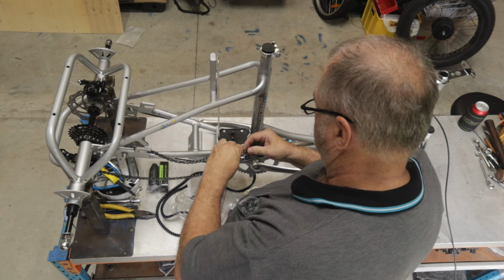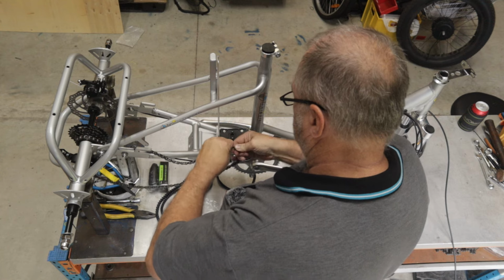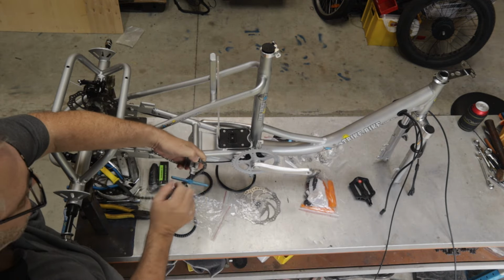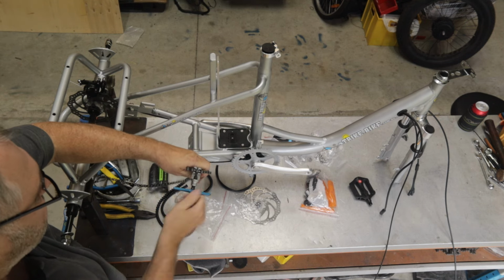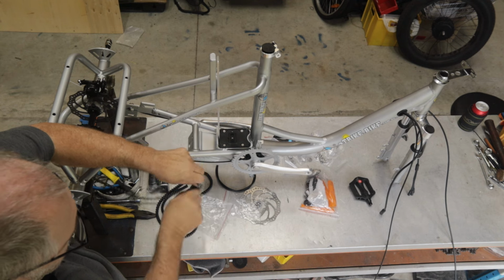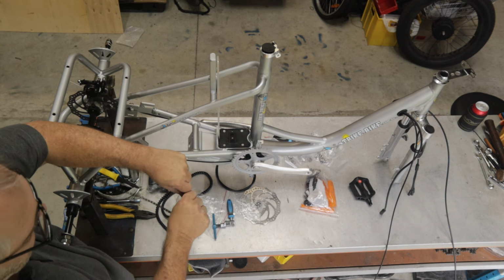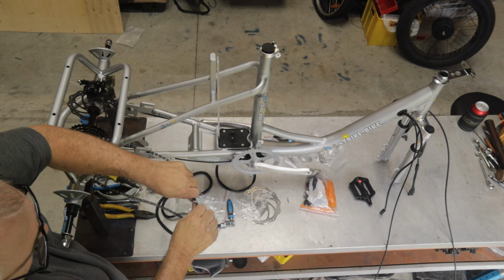Just going to squeeze that through. Sometimes it's a bit hard to get it in the right spot because the chain is lightly oiled and everything becomes slippery. So I'm pushing the pin through with our special chain link tool. Going to position it so it's about perfectly centered, and you'll see the chain is now quite stiff, so we have to loosen that up, and we do that by twisting it sideways to give it some freedom in the movement. You can see now it's moving quite nice.